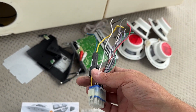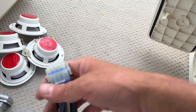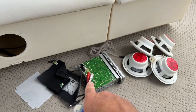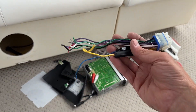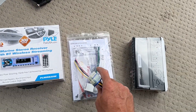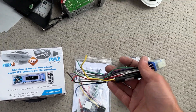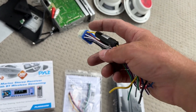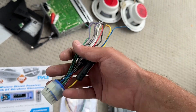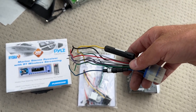One thing I did was rip apart the old radio and take out the original wire harness, because that plug connects directly into the factory wire harness. I opened up the back cage and cut out the wires, so I now have a full wire harness whose colors line up with the colors on the new head unit. I'm going to splice those harness tails together by color, then I can just plug it right back in and everything should work.